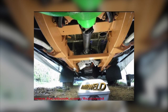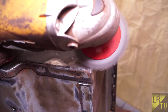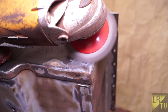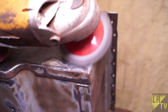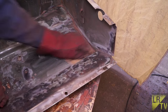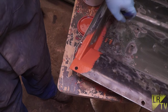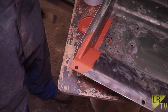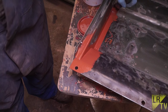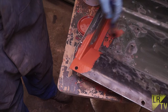It is exactly aimed at Land Rover owners, as the owner of BuzzWeld is an owner himself. With automotive rust, we know that rust grows underneath the paintwork, so we need to move the paintwork back so we've completely uncovered the rusty areas. This paint primer is very handy for boxes like this, where you can't quite get into the corners to kill off the rust — a heavy coat will keep converting the rust and stabilising it, so the box will not rot out in time.